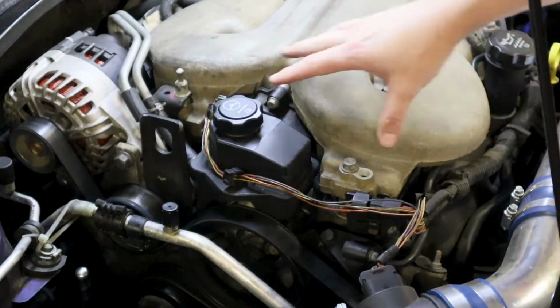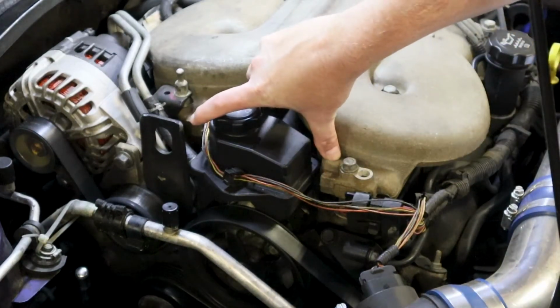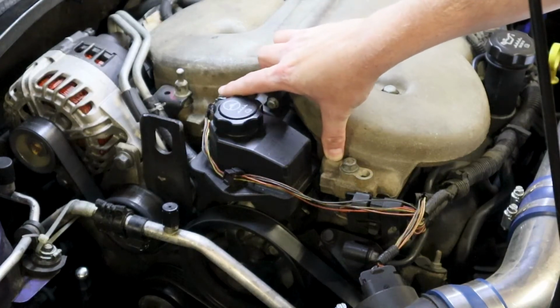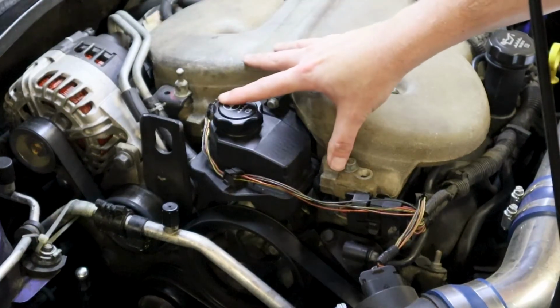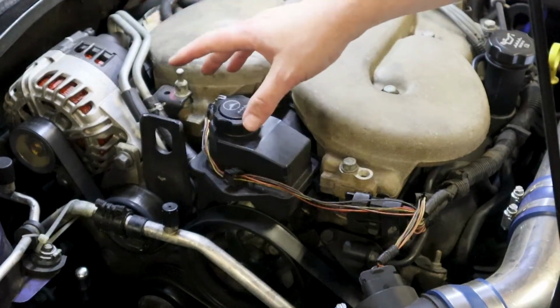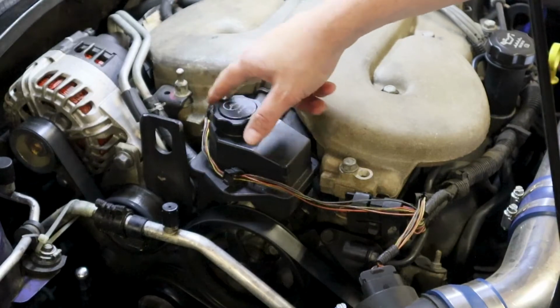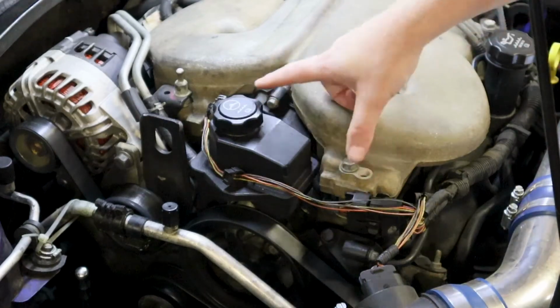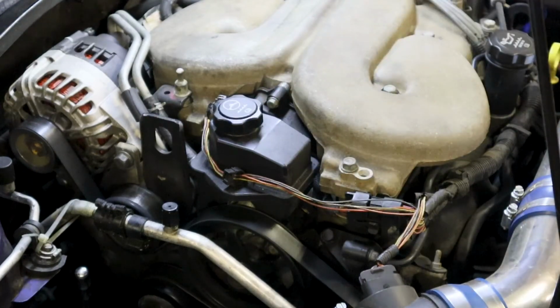Then it should creep up to 15 to 30% once the idle levels out and everything. And then above 1,000 RPM, the IMT should read about 70 to 90% duty cycle with that one wire. Okay, so keep in mind that those are your specifications for your signal coming out, telling the computer exactly what's going on with the position on this. And if that is not the specification you're getting, then you've got a problem for sure.